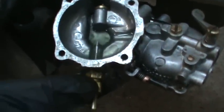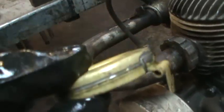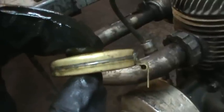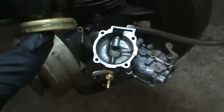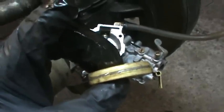Well, what am I going to try doing? I think I may try increasing that dent a little bit to give it a little more room to travel in the down position to shut it off, and bend the tab maybe just a little bit further. Not sure. I've got to get it to the point where I can shut the jet off though. As of right now, it just overflows the carb and you see it pissing out of the front of it, and it's just not gonna work like that, is it?